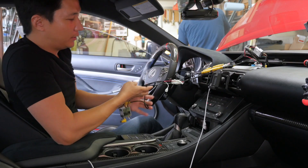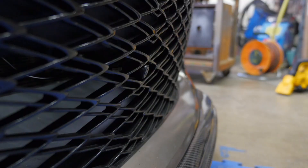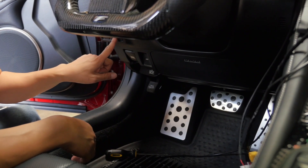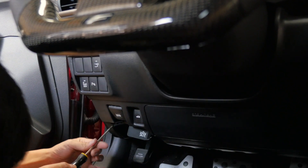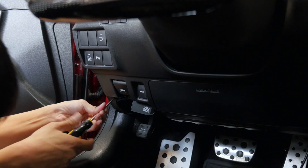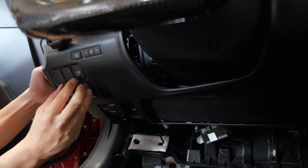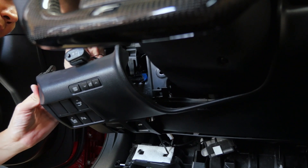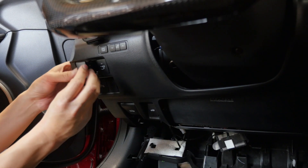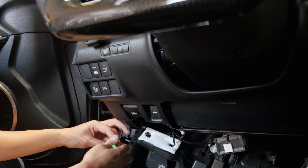This is how you connect it over here. We're still waiting for the front camera to come in, so we'll leave it like this for now so we don't have to pull it all out again. Now we're going to mount the front camera button. To do that, we need to drop this panel — there are two Phillips screws over here, so get your Phillips screwdriver and unscrew them. After you pull this panel, all you have to do is push the empty slot out from the inside as it's just held by clips. We'll place the camera button right here and it will clip on just like factory. That wire we routed is going to be connected to that.